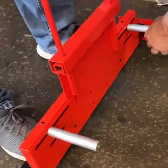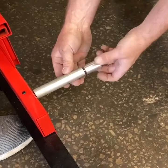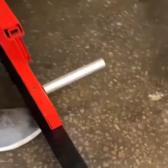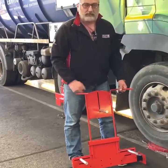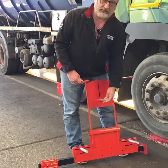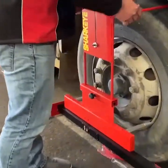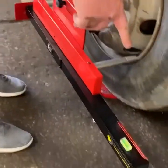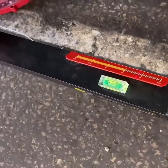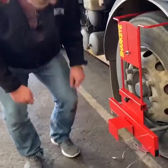Just finger tight — there's no need to drive them on. You're not trying to break it, you're not entering any strongman competitions. You need to get them back on, just finger tight. So you get it back on the same way as before. Make sure it's on. Make sure that your spirit level is in the right place. We've got exactly the same reading that we had before — we've got four. And now it's reflecting on to the rear mirror, and the rear mirror reflects back on to these rear tow scales here.